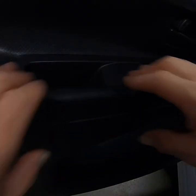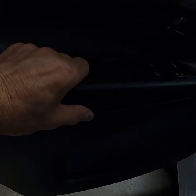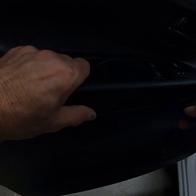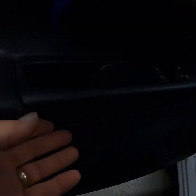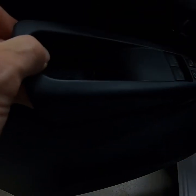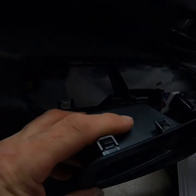I'm going to remove this panel by lifting straight up. If it doesn't pop all the way out — like mine is getting caught towards the front — I'm going to take one of my body tools, insert it, and pry gently, just work it loose. There are four tabs across the back, three or four on the bottom. Don't pull too hard and it should pop up off of there. Sometimes it feels like you're going to break something, and it is possible, but it's not very likely.